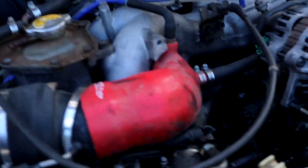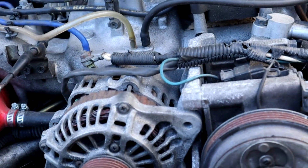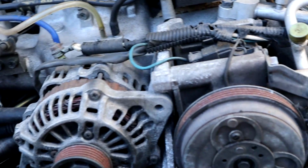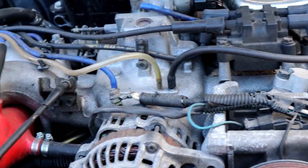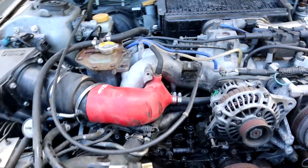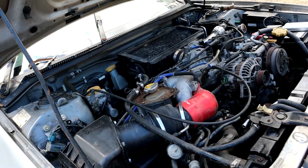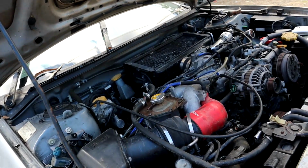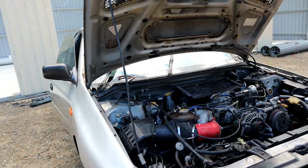That's what we've kind of got it down to: the bores. We actually had half a cup of water come out before that oil came out, water or fuel, whatever it was. We're thinking the bores themselves are all nasty, and by that I mean it's been sitting for so long, potentially with water in the bores and no oil, that it's pretty much just seized in place, and there'll be rust spots all up the bores, and it won't be very nice.